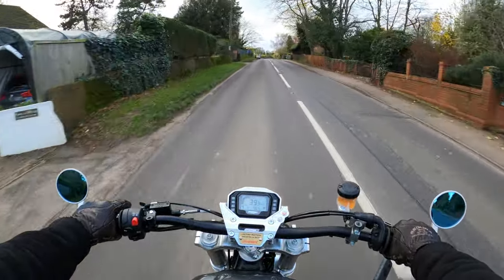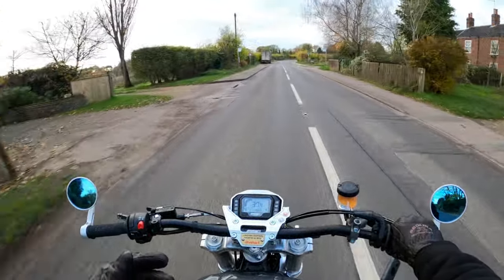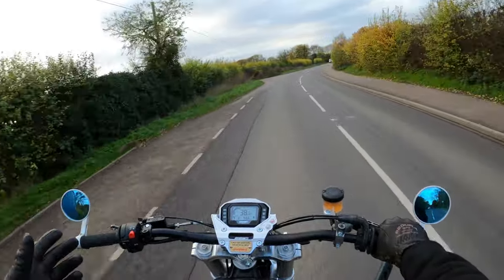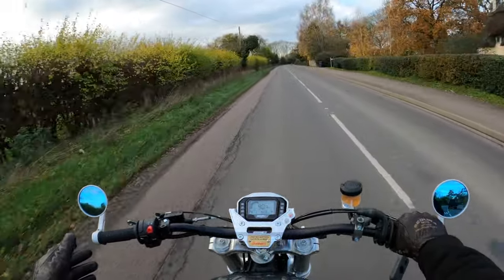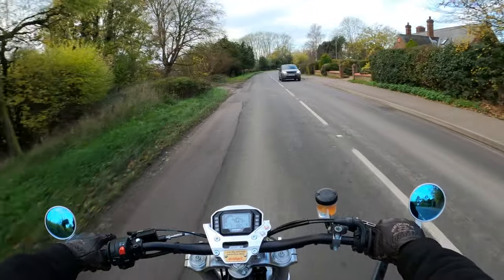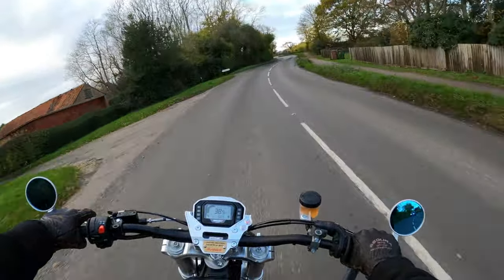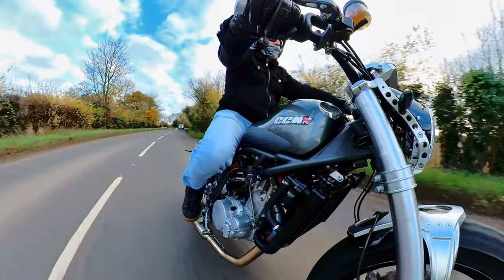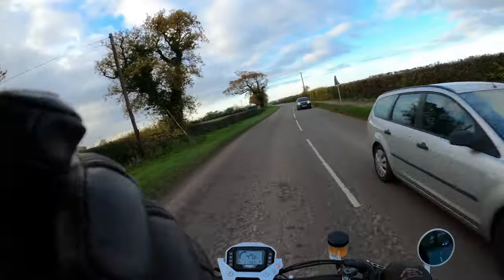Generally what you can do with the bike through the winter months. Especially this bike being a 600 single cylinder — it's got a lithium battery as well. This bike constantly remains on an optimizer, specifically set for the lithium battery, so it's got the battery management system on there. I leave this bike on that continuously and I've not had any problems — it keeps the battery maintained.